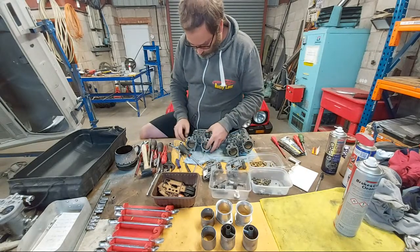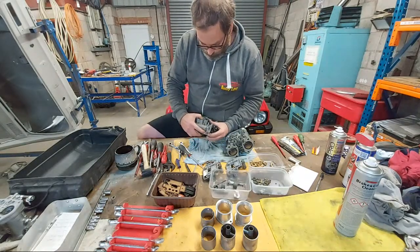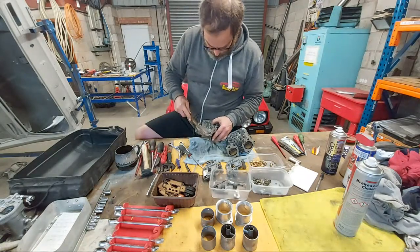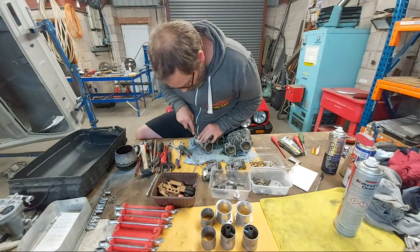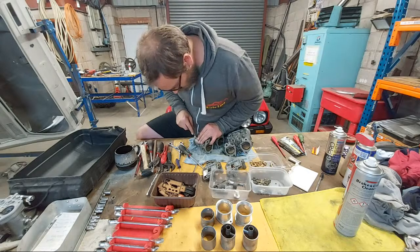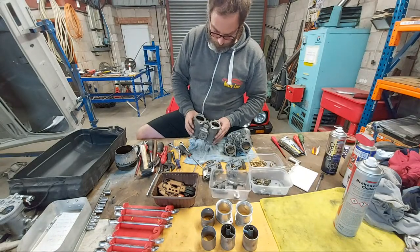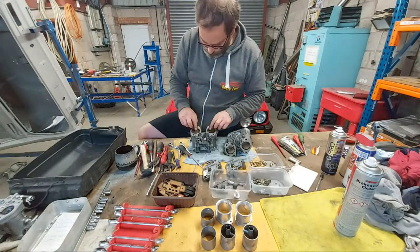Other progression hole screw, that's very good. Now, this penny washer jobby, I don't really want to stick a screwdriver through there because I don't want to score the aluminium, but it might be its only option. So let's give this a go, gently, gently, see if it responds favorably. Yeah, I think I'm gonna have to wait until I've removed the throttle valves and then give it a bit more. I'm gonna take the throttle valves off now.